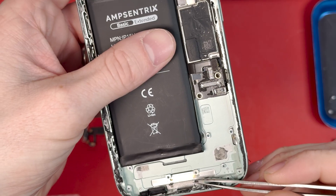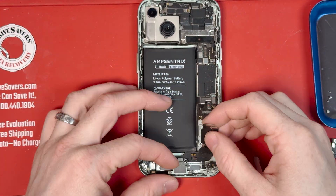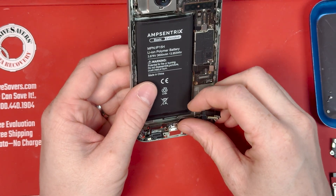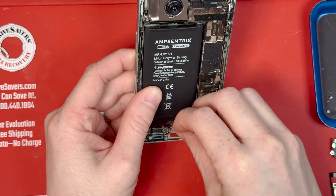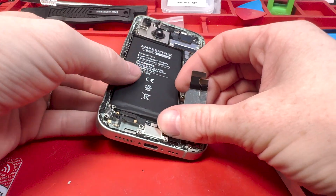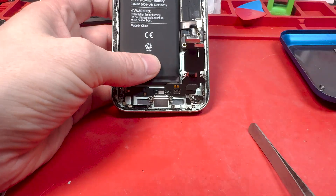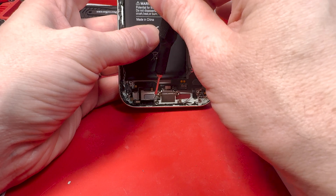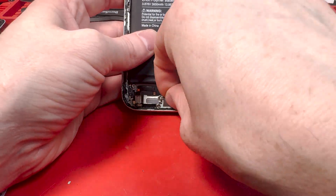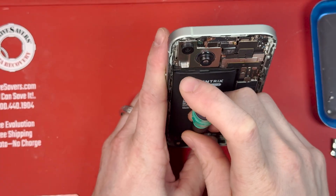We're going to get the new charge port in. Be aware of the brackets — make sure they're on the side of the plastic on the top part of the plastic. Lay down that part first and get it aligned before worrying about aligning anything else. If you've done an iPhone 14 charge port, this will be very easy because the charge port is identical to the iPhone 14 — all screws are in the same spots and same sizes. The iPhone 15 is essentially the same phone except the charge port is USB-C instead of Lightning. Grab your PH000 screws and screw them down by the charge port.